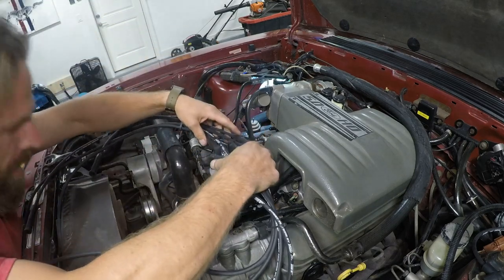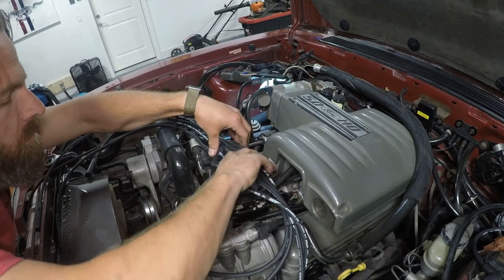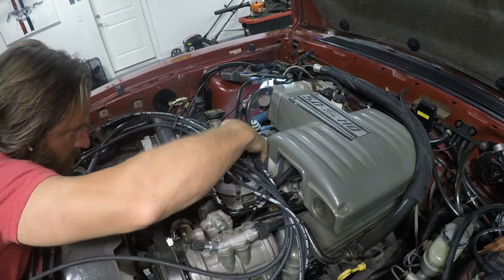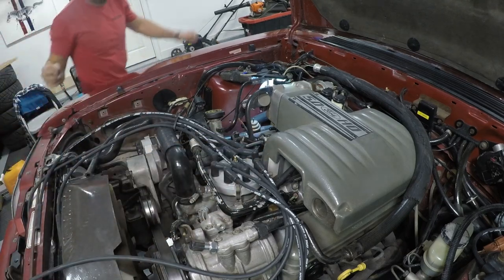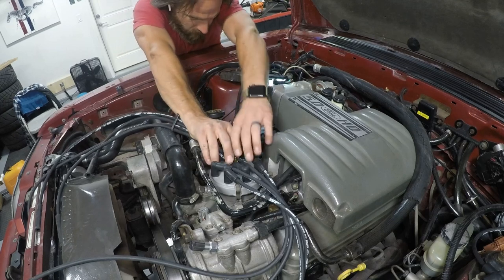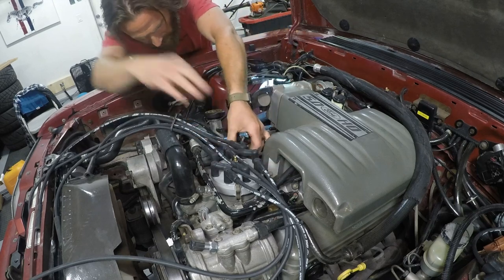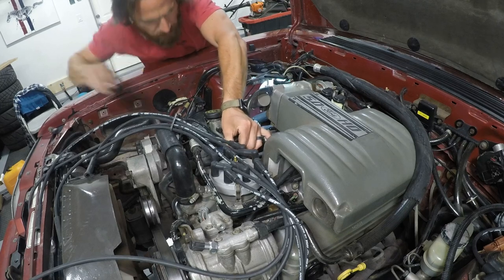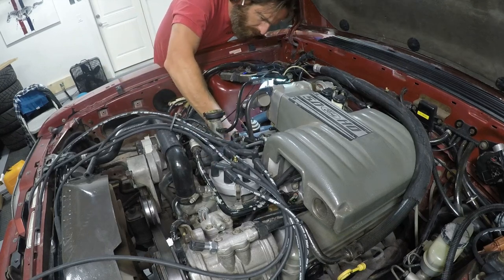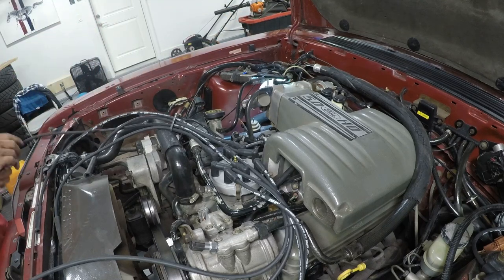Just line it up and it'll essentially fall into place so you can lock the two clips back onto the cap. From there it's just a matter of draping your wires into place in a format so they're not going to get burned or rub on anything that moves. Keep in mind the engine moves around a lot and there's a lot of breeze running through the engine compartment, so you really should have your plug wires away from anything they can touch as best as possible.